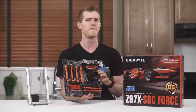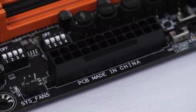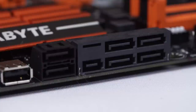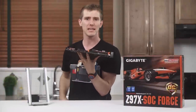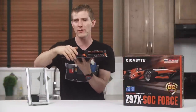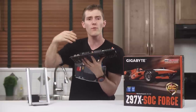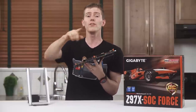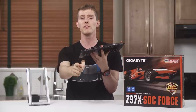The 24-pin power is in its ideal location. For storage, we've got the option to use either six standard SATA 3 6 Gbps drives, or four of those and a single SATA Express 10 Gbps drive. SATA Express is a new standard that is backwards compatible with existing SATA drives but can use PCI Express over a cable for improved latency and throughput. There aren't really any drives yet, but when new 2.5-inch SSDs arrive using this connector they will be able to deliver better sequential performance than previous models.